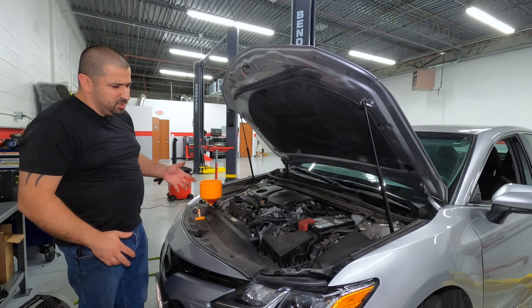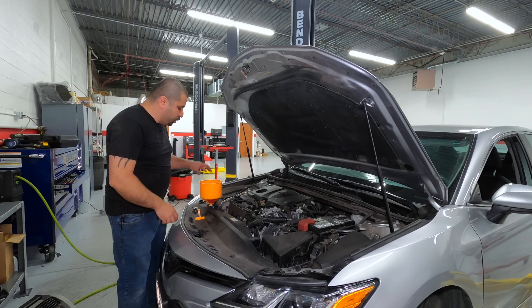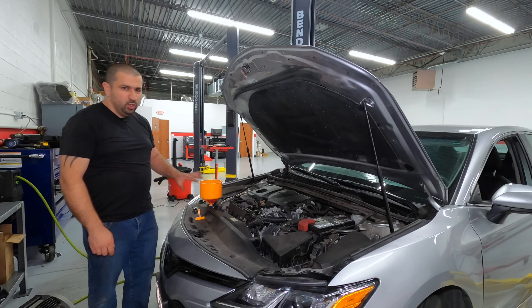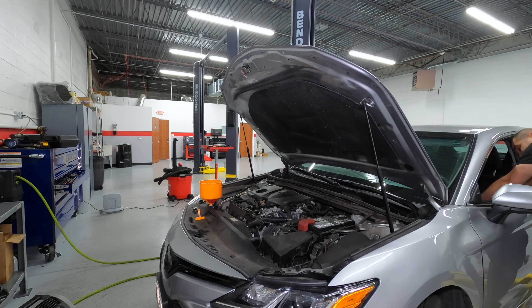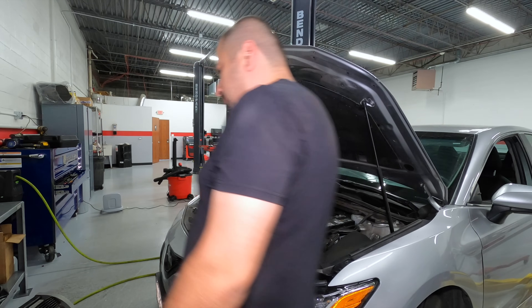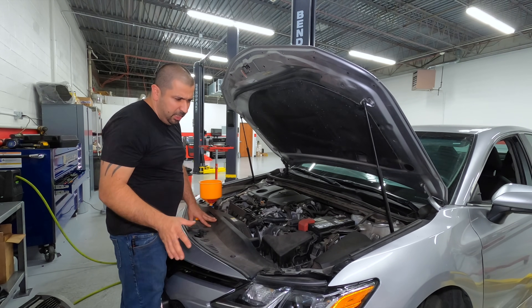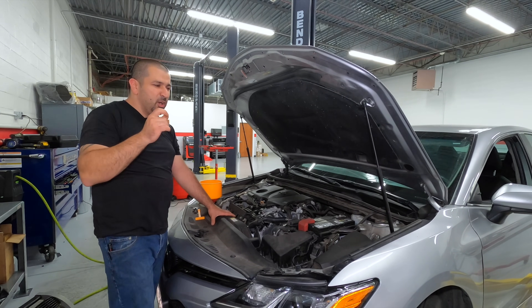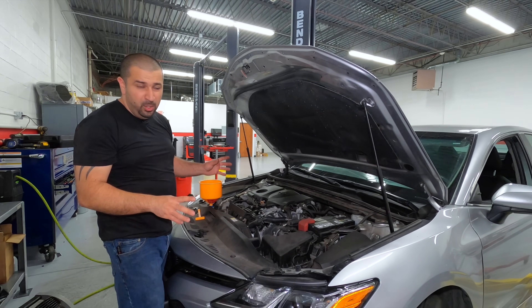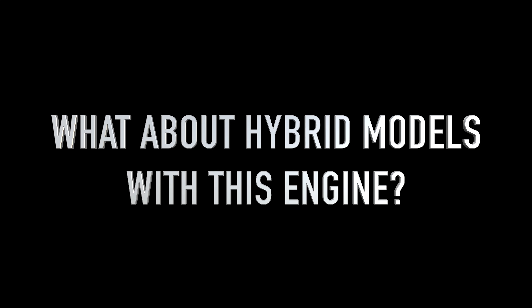Let it run at high RPM — think of it like a long highway trip, it's basically the same thing. You'll notice the coolant keeps burbling; make sure the coolant in the funnel is not very low — keep it at least halfway. When the idle comes down, go back and raise the RPM again since Toyotas start at a higher idle. We're running just over 2000 RPM. Important: do not turn on the heater — it takes the car out of coolant bleed mode. Heater off, blower motor off, AC completely off.